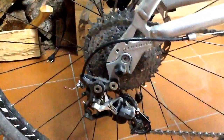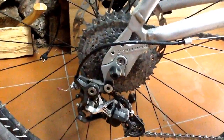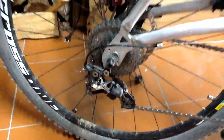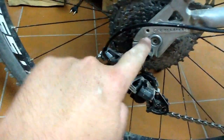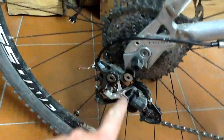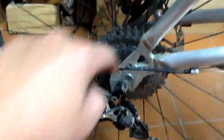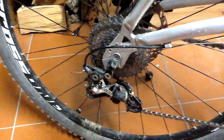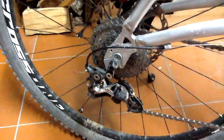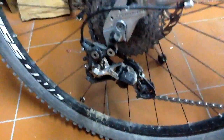On the back I've got a 10-speed Shimano Saint cassette. I think 11 is the smallest tooth — I might put the biggest in the comments. Great derailleur. This is actually my second one — this piece broke on mine. I didn't even know frames had this sort of sacrificial piece. It broke, and the derailleur went into the wheel and got bent. I tried to straighten it but it only sort of works — the tolerance on the 10-speed derailleur is quite high and there was no way of configuring the gears properly. So in the end I switched it for a new one, which works perfectly.